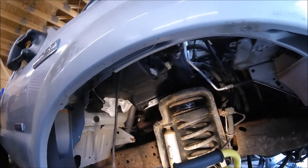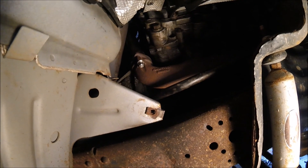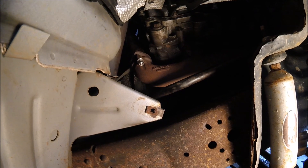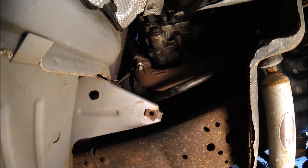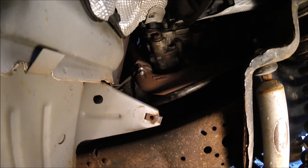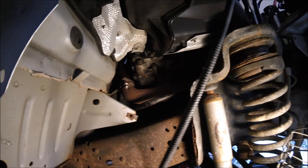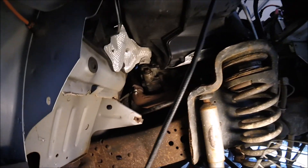On the front and back side of that flange, I ran a little bit longer 5/16ths stainless steel bolt through there, a washer on both sides, a lock washer, and I double-nutted it. Hopefully this doesn't come back apart. Got that back together — next step is probably going to be to run the glow plug harness on both sides and then put everything on top of the motor back together.